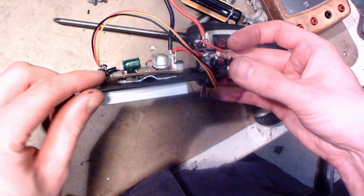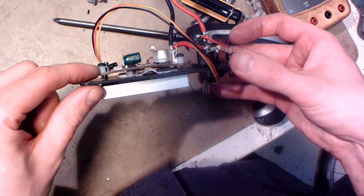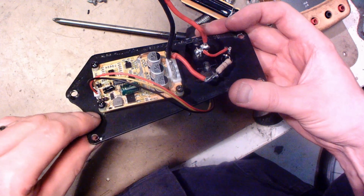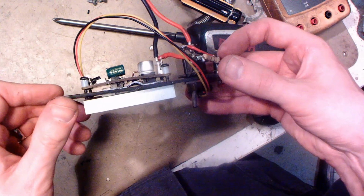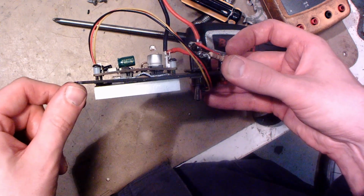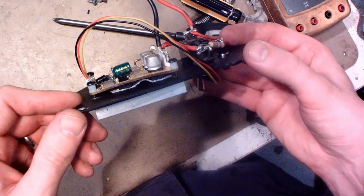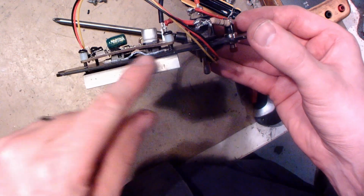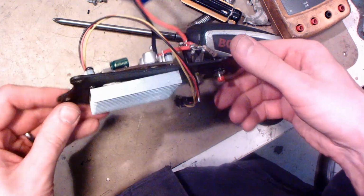I placed those plastic washers, spacers upside of this PCB. So now those screws cannot make short circuit. This is the wrong way. You can see the whole PCB is bending now, but at least there is no short circuit anymore, or even possible. One possible is that those FETs are very near this side panel, but it works, I think.